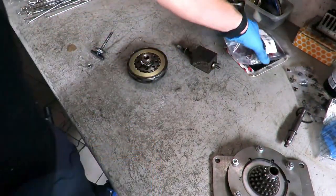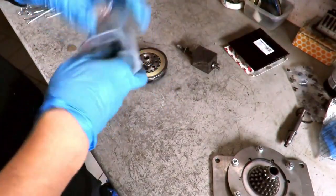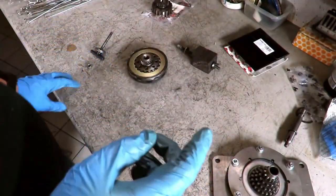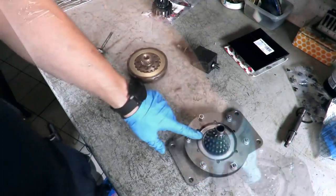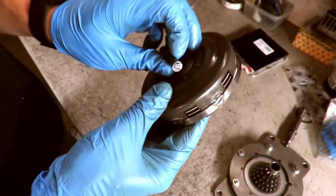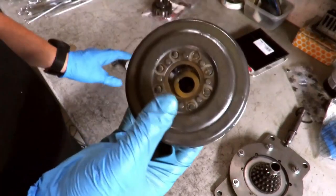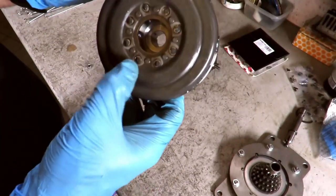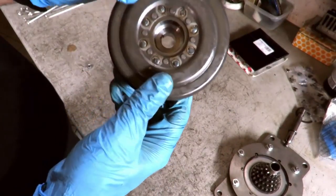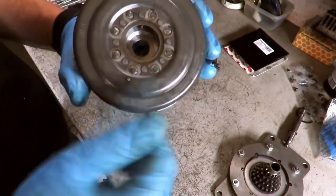So, as I told you, the primary is a DRT, specifically the ratio will be 24/62, Arcobaleno gearbox, quadruple from 21 and fourth to 36 teeth. That of the 125. The clutch will use a reinforced Newfren, which at quality price ratio is truly an excellent product, since it solves all the problems associated with this type of use in an excellent and cheap way.